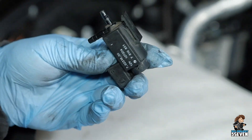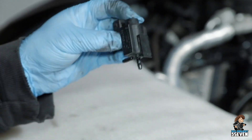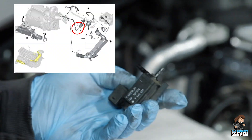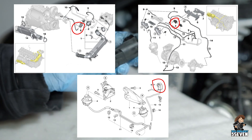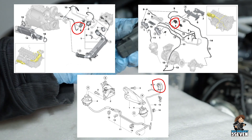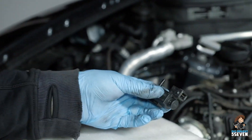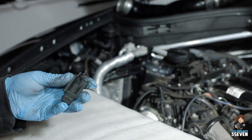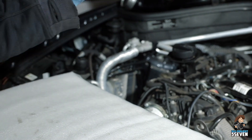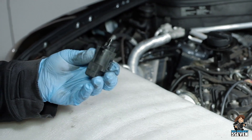This is an electric switch-over valve from the EGR cooler. There are actually three of these in use in both 335 and X5 diesels. One is for the EGR cooler, one is for the motor mount control under the intake manifold, and one is at the very back of the turbo control bracket for compressor bypass.